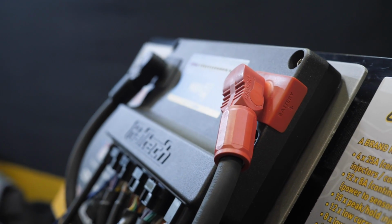So just talking about the control we've got over the electronic fusing, if you like. So we can set a particular output. Say we're talking about a fuel pump. So you can set the current at which the circuit will trip or break down, but then you can also reset that as well. Can you tell us how that works? Yeah, so at the moment the way it works is you've got a peak current where if it exceeds that, it will just switch the output off. Well, go into the retry state, which I'll explain afterwards.